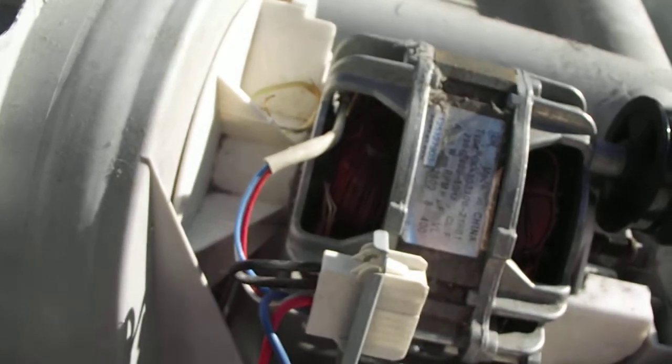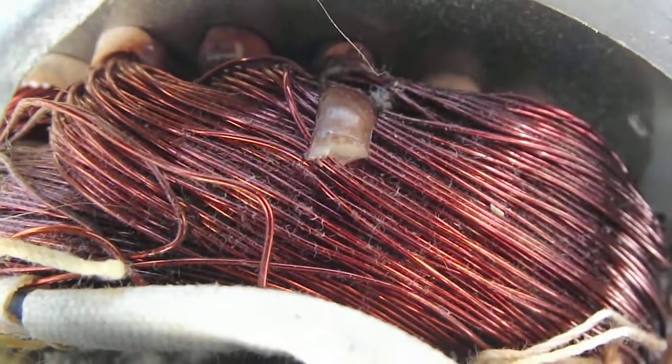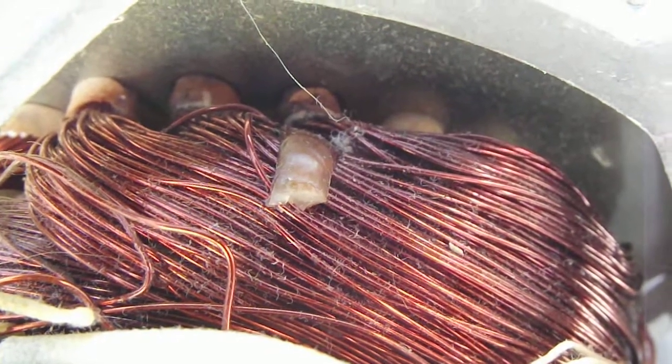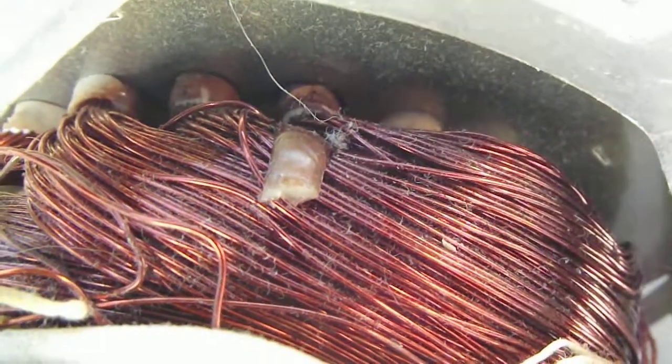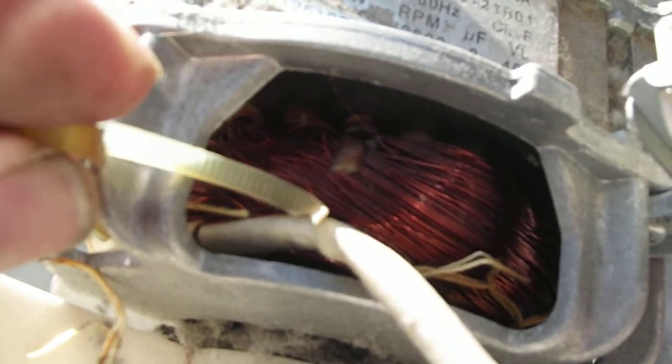What I noticed was extremely worrying and very dangerous. In this dryer you can actually see — take a close look — there's a cable tie that has got burns on it. The armature's coil assembly got so hot it burned the enamel off the motor winding, burned the cable tie. The other part of the cable tie was floating and jammed inside the motor assembly. There it is — you can see it's actually melted at the end. That was jamming up the motor assembly.